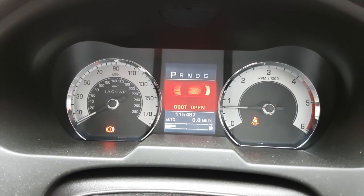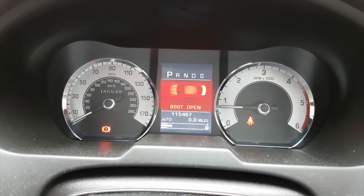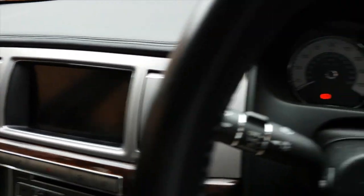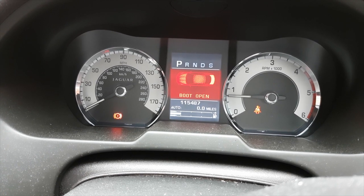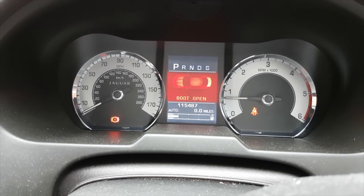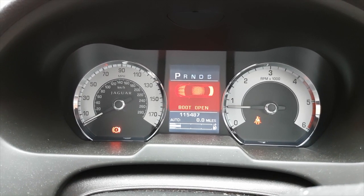I found the first thing that would happen was that the D here will start to flash, and it's a gearbox fault, as it's not got any power to shift ratios. And then you start getting various other things. You find the infotainment will shut down. Then you get ABS not available, DSC not available, as the modules just fall over one by one, you'll then get the headlights conking out, and the car will grind to a halt. Let's look into this and find out what's the matter.